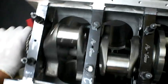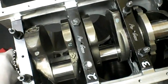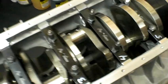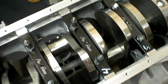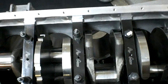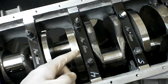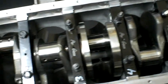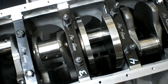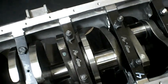I had to have the crank ground down 10 thousandths under. Originally, this motor had three spun rod bearings. When I purchased another crank — because my original crank was cracked — I tried to fit it in and the number 4 journal was hanging up; it was smaller than the others. So I had it line honed, and that fixed the problem.